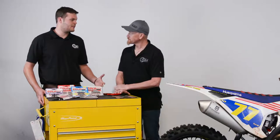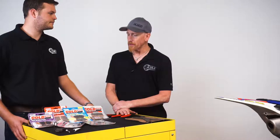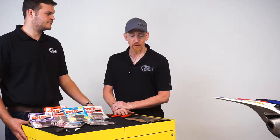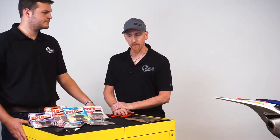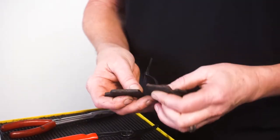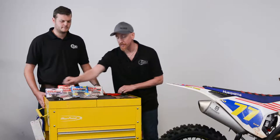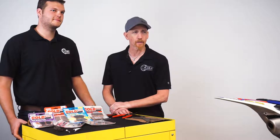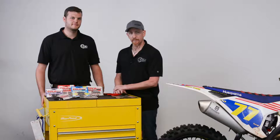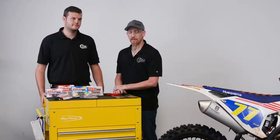So what are some of the things that the average rider might not know to look for, or some quick tips? You might look at the way the pad material looks — see if it's been overheated, see if the backing plate looks scorched, or if you have some extreme condition where your brake pads are actually bent; that might indicate there's a problem. You might want to refer to the brake bleeding video and change your brake fluid. Most brake pads come equipped with a wear indicator, or look at the pad surface material — if it's actually thinner than the thickness of a penny or a dime, it's time to replace them.